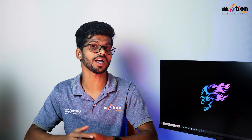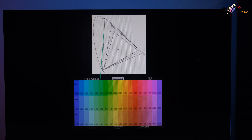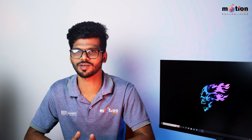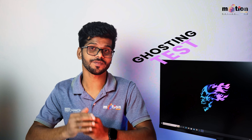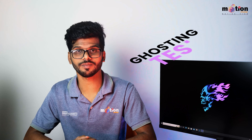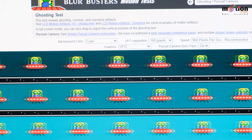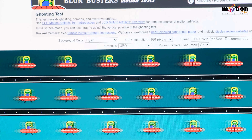The outside setting with the sRGB profile produces beautiful color. However, there is a negative — there is noticeable color shifting in the corners. Using a Spyder 5 Elite colorimeter, the monitor measured 120% sRGB coverage with 99% accuracy. There is also some backlight bleed visible in dark scenes.